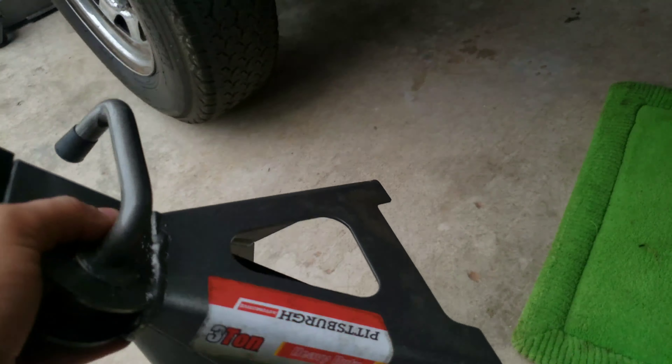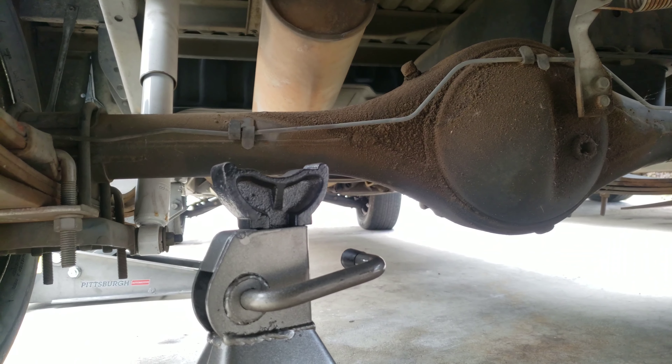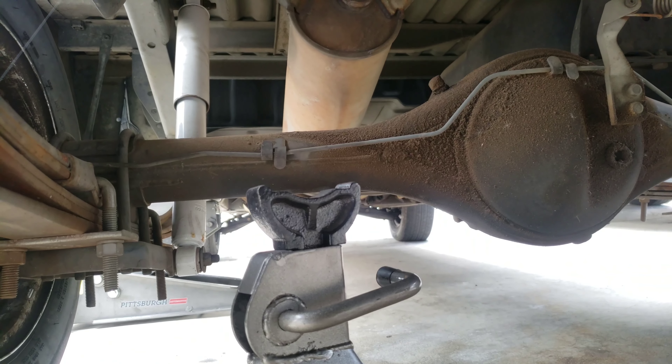Let me show you instead of just telling you. We're gonna grab our jack stand. You could add it either in the bottom to hold it off, or add it over there right next to the frame of the vehicle. Because of the height it's expanding the rear shock, bring that jack and just leave it there for leverage under the diff. Make sure it's stiff when you lift — don't lift it all the way up because that's gonna compress the shock, and you don't want that. You want it fully expanded so it's easy to pull off when you remove that nut holding the rear of the shock at the bottom.